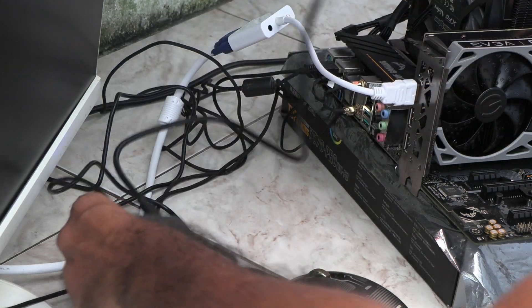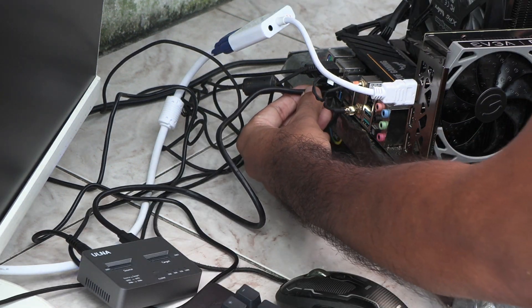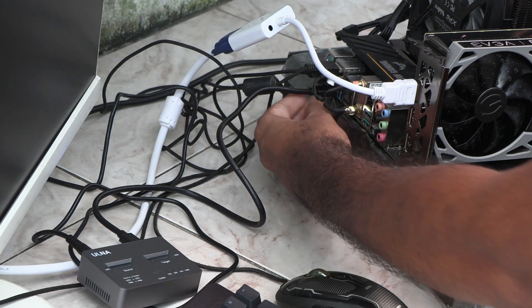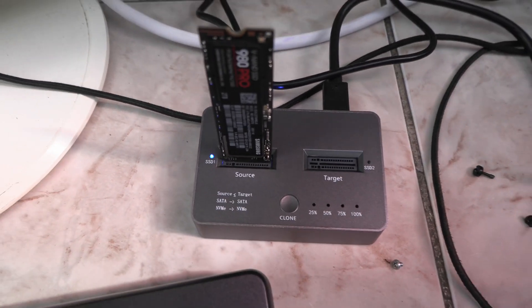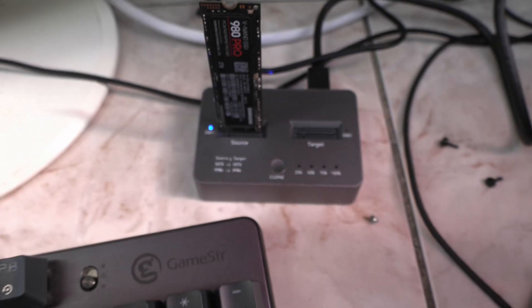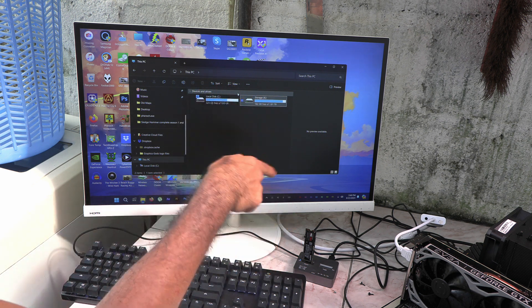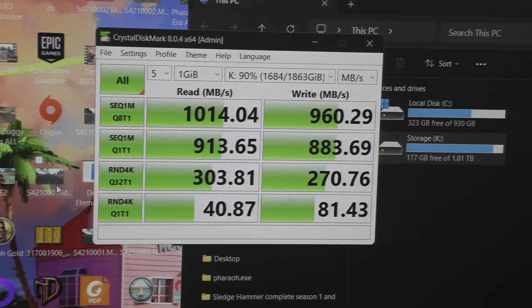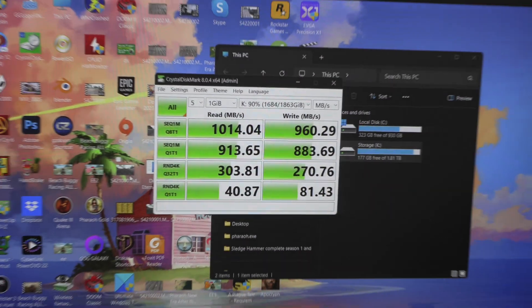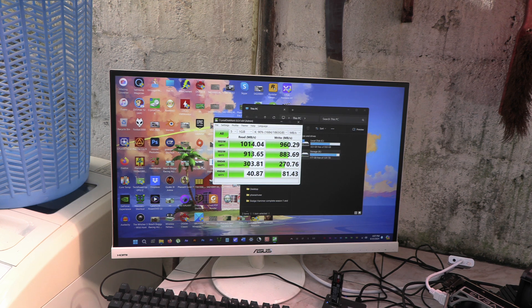To check the docking feature, I'm going to connect this straight to the USB-C port on the back of the motherboard to get the maximum possible data transfer speeds. I took out the second M.2 drive on my motherboard — the one I use for storage — and stuck it in the source slot. It's also a Samsung 980 Pro, but this one's 2TB. When I turn on the PC, it's just there, like nothing happened. For read speed I get slightly over 1000 MB per second, which is 8 Gbps — just below the 10 Gbps maximum you can get with USB 3.2 Gen 2.